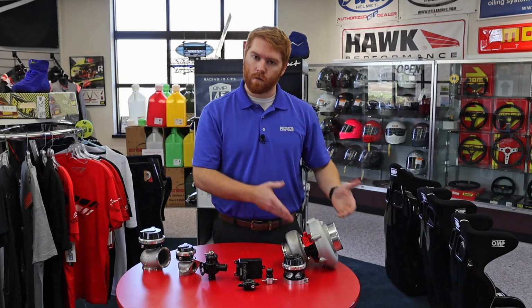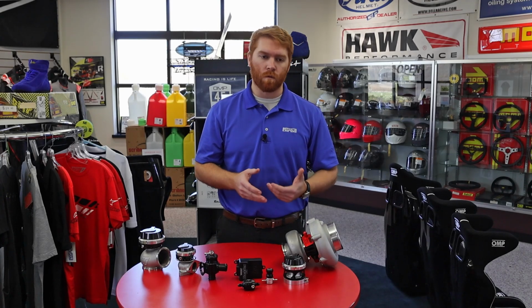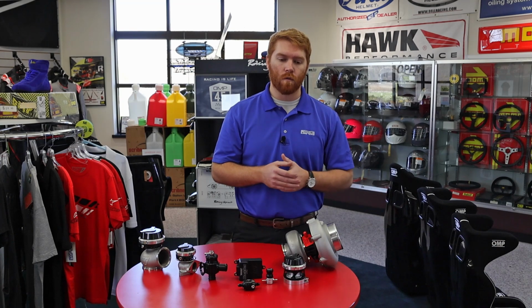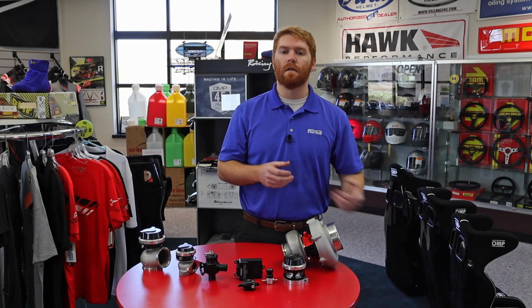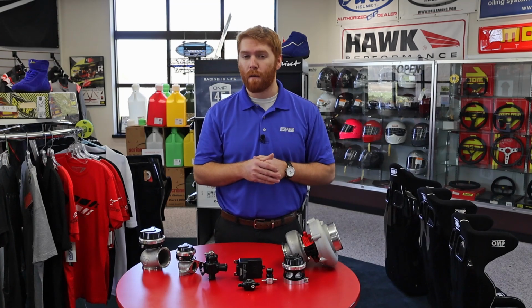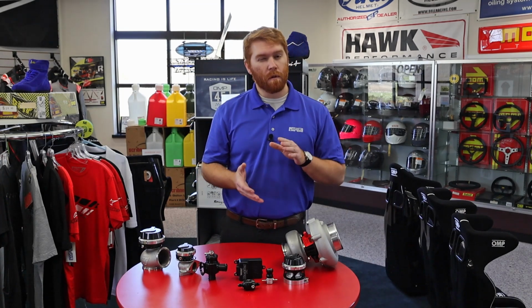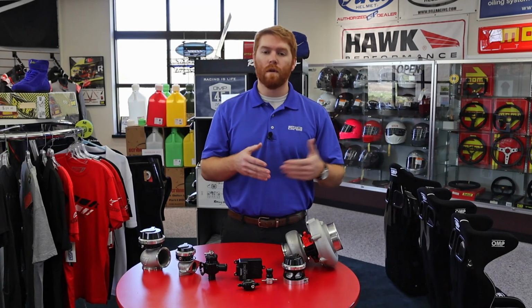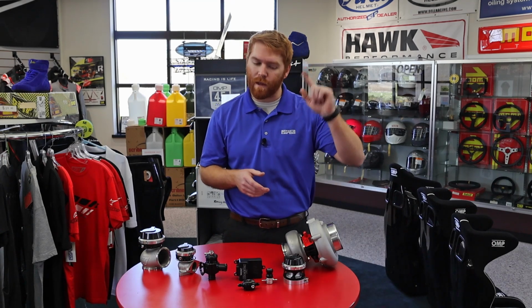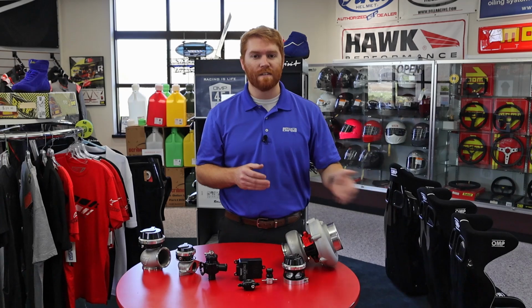So that's TurboSmart's solution. On top of that, you also have the drain side. Making sure that the oil is draining from the turbo center section is really critical. If you have that starting to back up, or if the drain size is too small, or if it's not routing to a place where it can naturally gravity feed drain well, you can have issues where the turbo oil backs up the drain. And when that happens, you typically blow out seals, you have other issues. To combat that, we do sell scavenge pumps that work really well. You would put it in the drain, and then you can pump it anywhere. You can pump it back up to the engine, you can pump it into the oil pan. It doesn't really matter, it's using pressure to pump it. So that works really, really well to making sure that the turbo oil drain side is really happy.